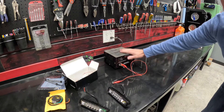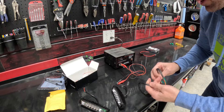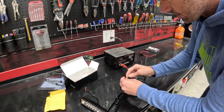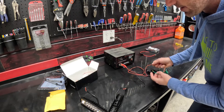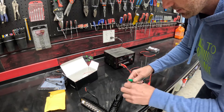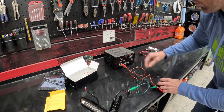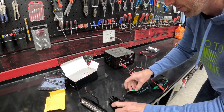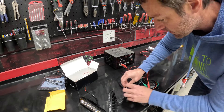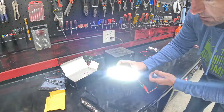You may have just noticed we have a switch on this, but we don't have a switch with a battery, right? So that's where our handlebar switch is going to come in. Our switch is going to go on the positive side — the red side — and it is going to go in between the lead coming from our battery and then to our light. Red goes to red, and the other side, which is green on this switch, goes to the red going into our light. That's all positive power — even though we're using green wire here, I just don't have another red wire. So we've got positive coming from our battery to our switch into our light. Right now our switch is off — if we turn on our switch here, nothing should happen. And nothing happened. Now once we hit our switch on our handlebars, there you go.